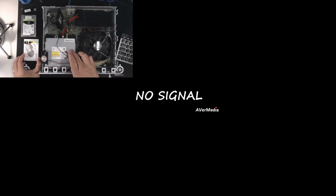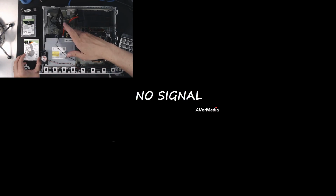If your system isn't producing a video signal, the hard drive could be at fault here. It could be a bad HDMI port as well, but if you don't see any physical damage to your port, it may very well not be that. Some of the other issues that you'd see if there's something wrong with your hard drive is anything other than an E100 error. E100 is referring to the optical disk drive, which could be just you've somehow accidentally disconnected these connectors, or something's wrong with the firmware, in which case you have a bigger problem. But any other error other than E100, so E106 is common, E101, E102, I think E305, there's a bunch of them, E200 something. Any of those errors are likely something to do with your hard drive.